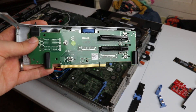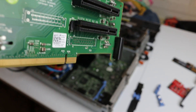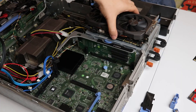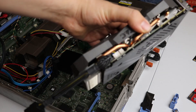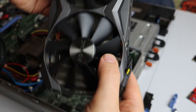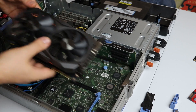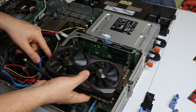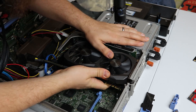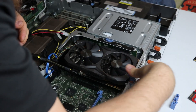This is the PCI Express 8X slot that I modified to take a full-size graphics card, just using a small air tool — I'll show you a clip of that probably at the end of the video. Here's the card ready to go into the server. I've got everything pushed as far as possible; I even bent the wires a little bit sharper than they came from the eBay seller just to get every last millimeter. This is a pretty hard-to-reach spot because of where all the metal brackets are, so just be really careful when putting in your card that it doesn't jam up on you.